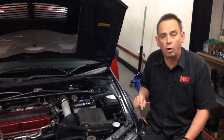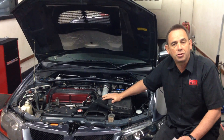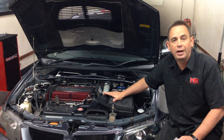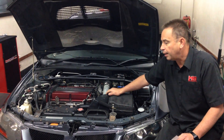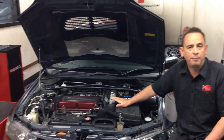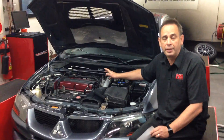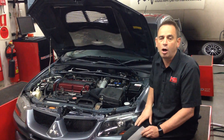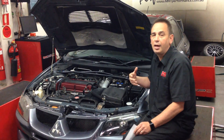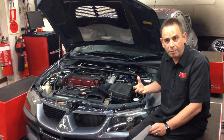Let's talk about the car overall from an Australian point of view, which is pretty typical of the worldwide use of this model. Being a JDM — Japanese domestic model — car, in Japan these cars are tuned for 100 octane fuel, and most markets around the world don't have 100 octane fuel, and in Australia we certainly don't. When you bring this car into Australia and run it on 98 octane fuel, the ECU has only a limited ability to adjust itself to protect the engine from excessive knocking, due to the ignition control map designed for 100 octane. It dumps in a heap of extra fuel to richen up the mixture and reduce the risk of engine damage, which ultimately manifests as damaged cracked pistons, big end bearings, and things like that.